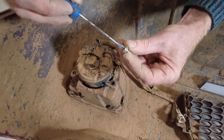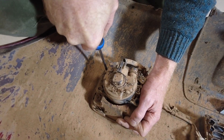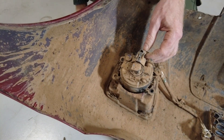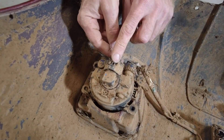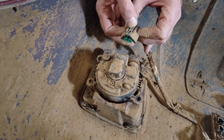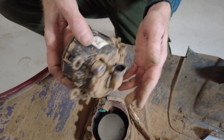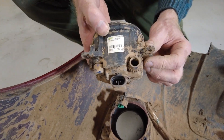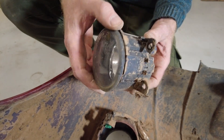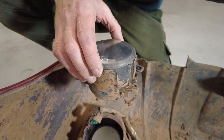It's got two fixing screws — give me that one, George. Got the second one. To get the connector out, you've got to push on this back bit here — it's got a little ribbed bit at the back, squeeze down there and you can extract it, then remove the fog light. These are the old halogen fog lights; both the left and right are the same.